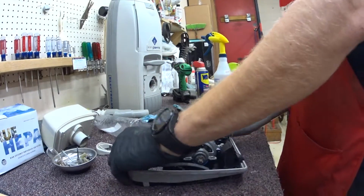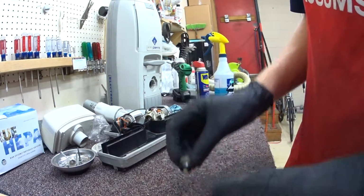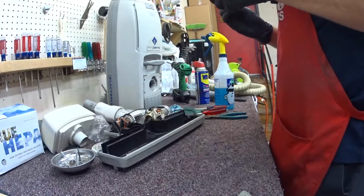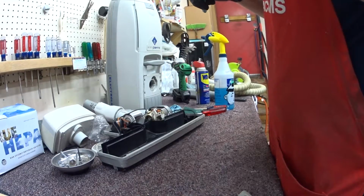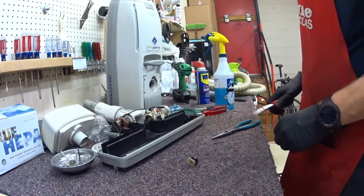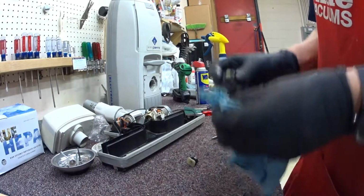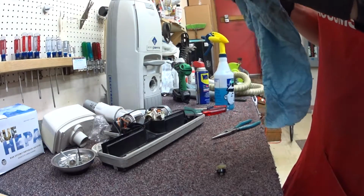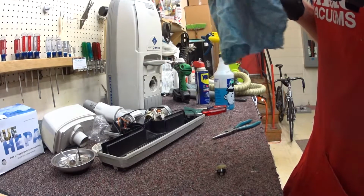Really still pretty loose. We're just putting those on there. Right. So the next thing is these are not sealed ball bearings. These are open and gritty. So when I wash the brush roller, I pull these off beforehand. Actually clean some of the bearing. So the grease is old enough in these that the grease has dissolved to the viscosity of like a thick differential oil.